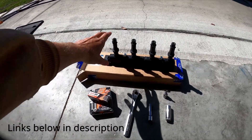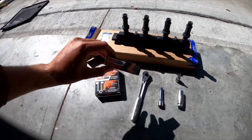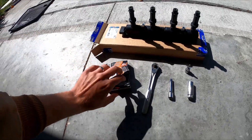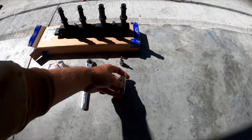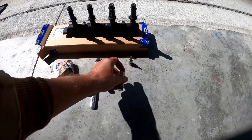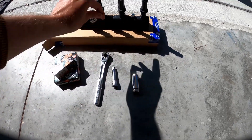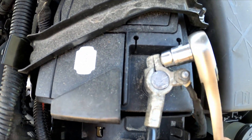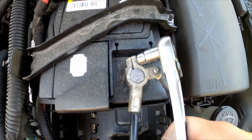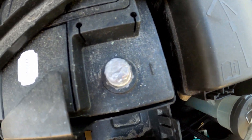So I'll be replacing that today. I just ran up to Advanced Auto Parts and got a replacement coil — it's an AC Delco. I also went with iridium plugs; you need four of those. You'll need a wrench, an extension, a 5/8ths socket for the plugs, and a T30 Torx bit to take off the ignition coil. Also, before you start, you should disconnect the battery. This clears out the codes, so once you install the new parts, you'll be able to see if it actually fixed it. If the code comes back, that means that was not the fix.